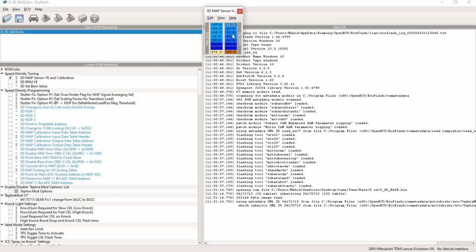When you do that, I like to start with left and right side, which is a 1-to-1 ratio, the same. And then this, I just scale it up to, you know, what is it, 550 load that it can read up to. I know that's 400. Let's just do 400. I'm basically telling the computer, okay, let's adjust this to 400. And at 400, I want it to read 450 kPa, so it gets a little richer on top. So that's one component down. This is the VE table versus RPM, you set it to whatever you think the stock one does. And then what's the next item? That's the MAP 5-bar, we have done.